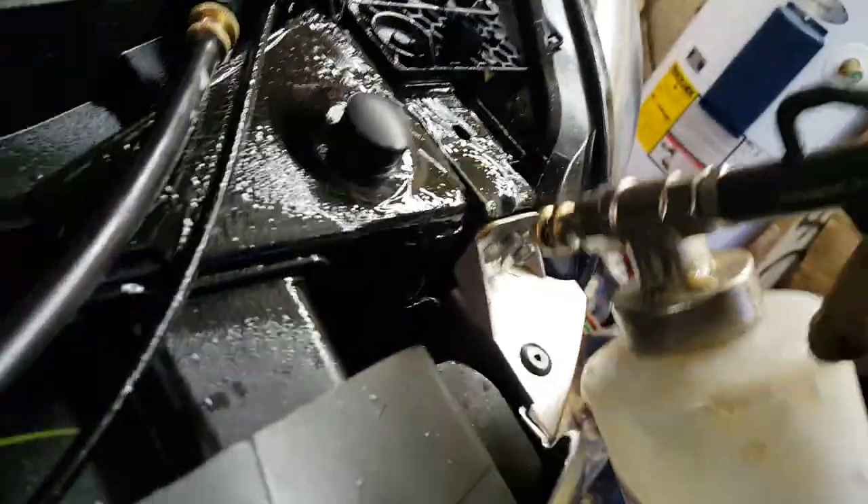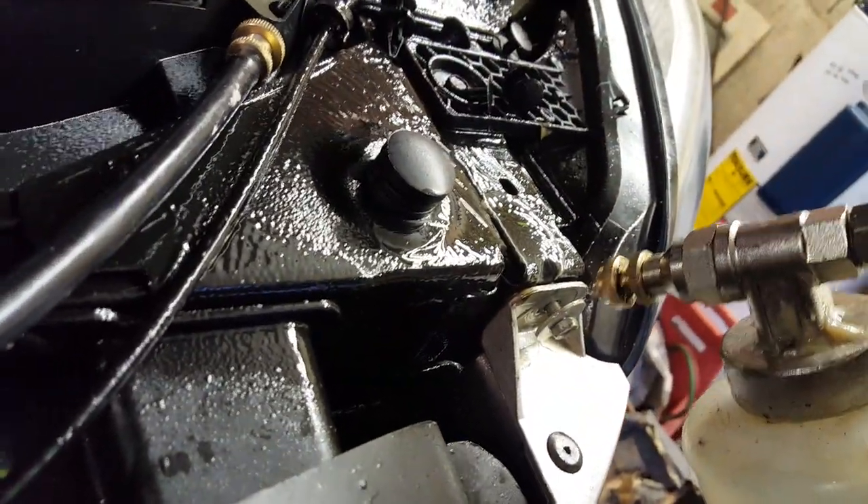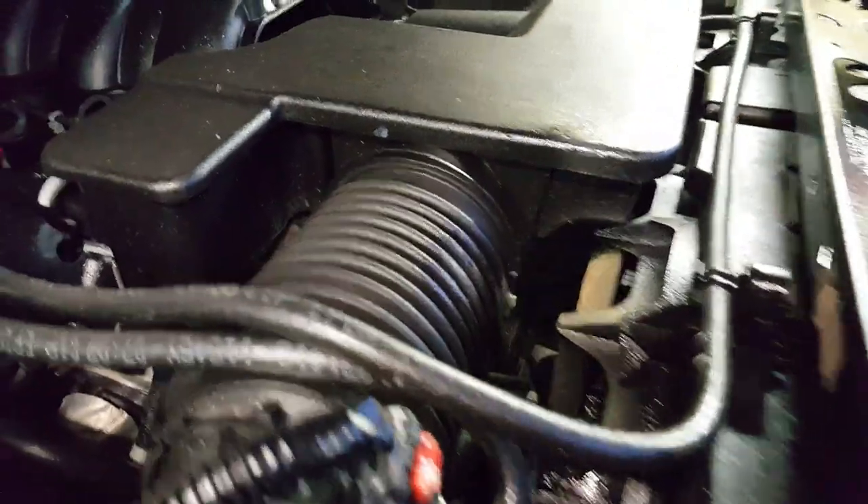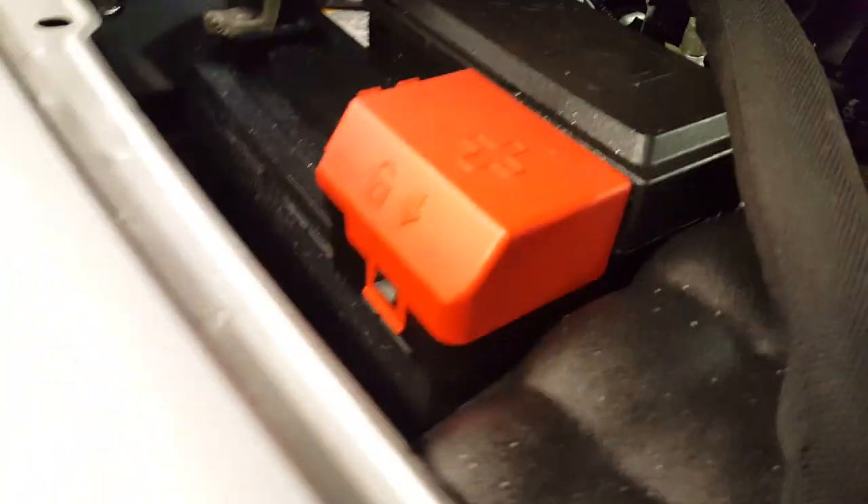Wool wax stops the salt and calcium. I even removed the bumper cover bolts — it's all one piece so I couldn't take off the bumper cover completely, but I sprayed behind the bolts into the threads and the hood latch mechanism. This Yukon actually has a flipper door apparatus so the radiator doesn't get direct air, just like the big rigs. I took out those bolts, sprayed them, put the cover back, and sprayed everywhere inside the radiator support and underneath. When I was in South Carolina, I sprayed the engine, pulleys, alternator, idler, A/C pipes, heater hose connections, battery terminals, and hood hinges.